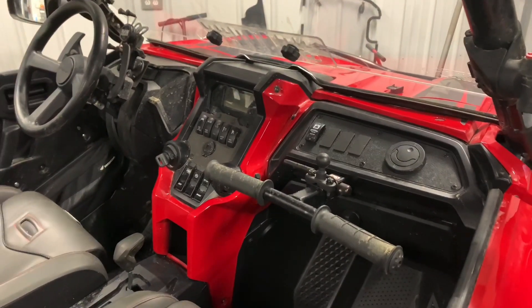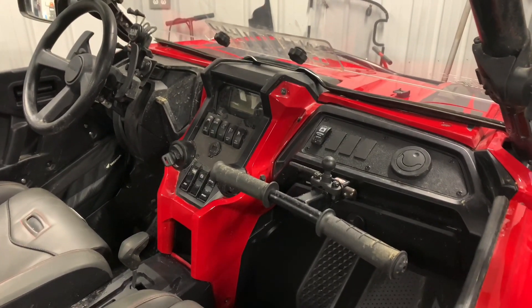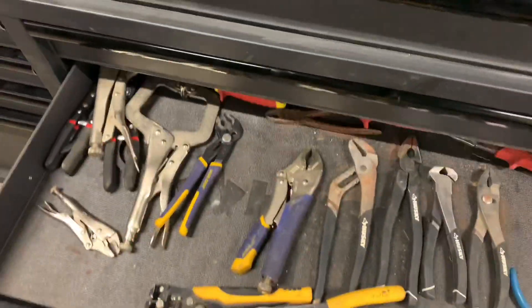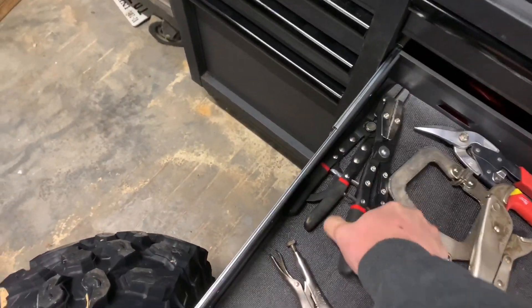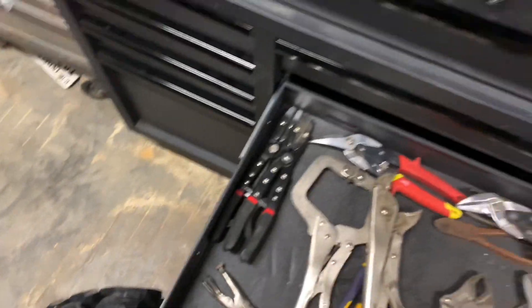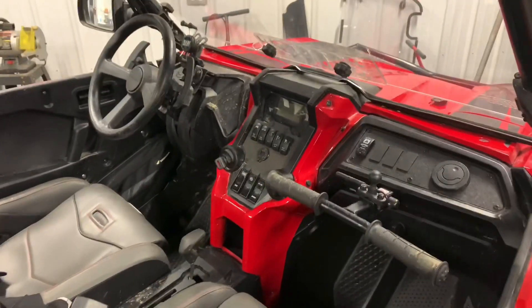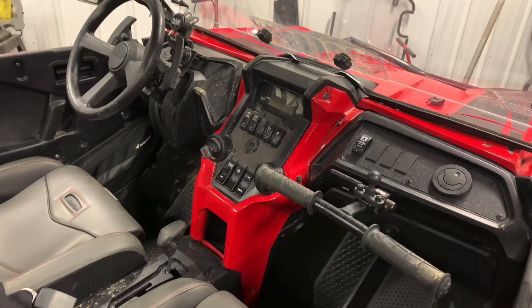In this section of the video I also wanted to touch on a few things you'll need to know before you start your install. You'll want to have some sort of method to clamp your heater hoses off — I went with two of these heater hose pliers clamps, and I'll have links to those in the description. You'll also want to get some additional coolant to put back into the machine after you splice into your heater hoses because you are going to lose some coolant.